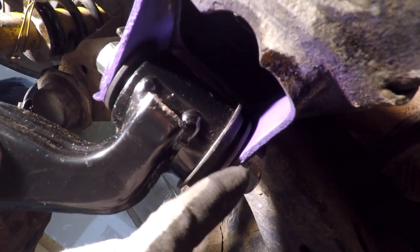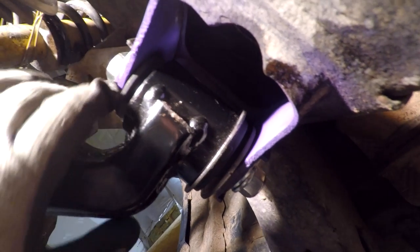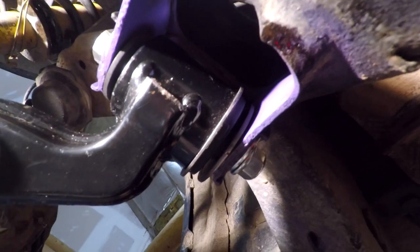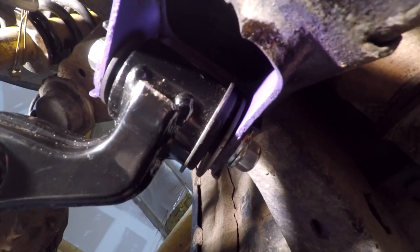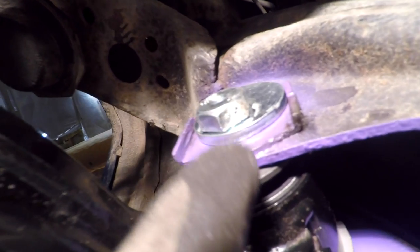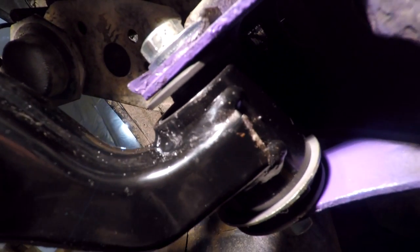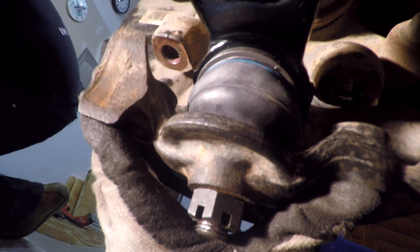We didn't have any black paint so we used purple spray paint. I came back from going to town and Charlie had gotten the control arm off — he ground down the metal, got it ready, and then we put the new control arm in. We're just kind of getting the caster and camber adjustment bolts in, guessing where they need to be, and we're going to measure the toe on the tire after we get that all done. We got the lower ball joint connected. We've reached the stopping point for today — we'll continue tomorrow. Thanks for watching, hats off to you.